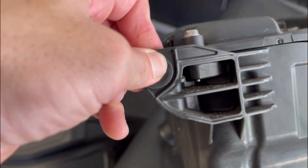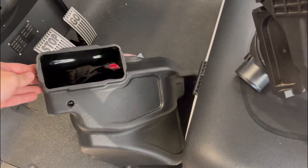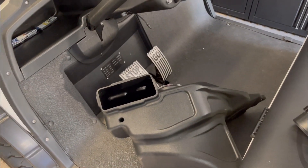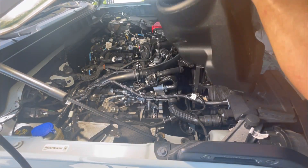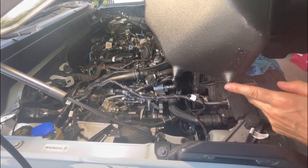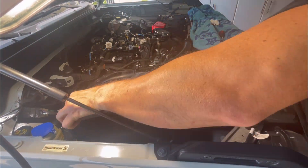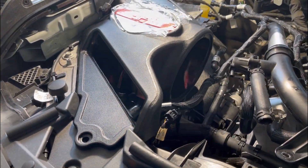Now I'm going to pull this out using the vice grips to keep tension on that, and we'll pull that out. Now we're going to pull out this grommet — take it off the stock airbox and put it on the Eventuri. This cutout right here is going to go up against the side of the car and will be blocked, but if you ever want to put a snorkel on, you'll have that option. We're going to put the Eventuri airbox in — line this up, the little rubber grommets on the bottom drop down into place, then we secure it to the sidewall with the factory bolt.